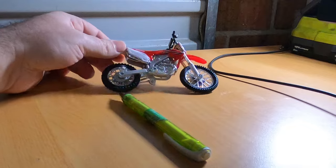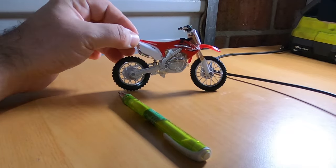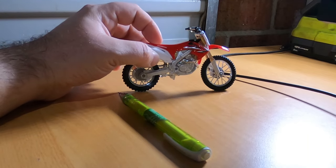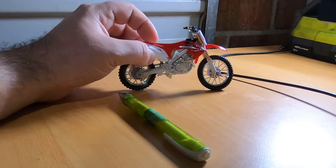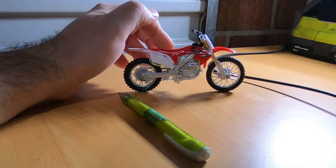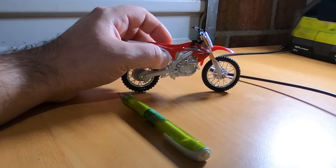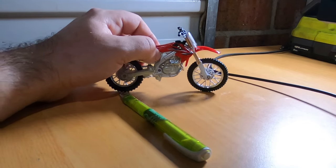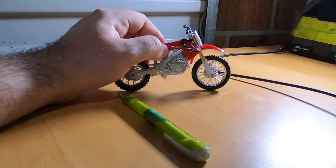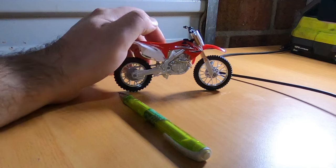So that's all I wanted to explain today. Adjusting your preload — making your spring tighter on preload — is not going to make your suspension harder. It'll only make it harder if you preload it more than the force you're going to put down when you sit on the bike. I hope that makes sense. If you have any questions, just leave them in the comment section. If you like this video, hit the like button, don't forget to subscribe, and ride safe.